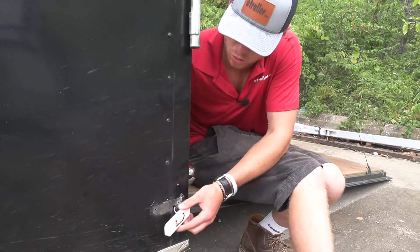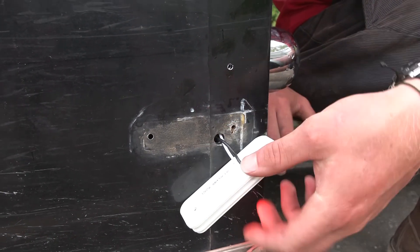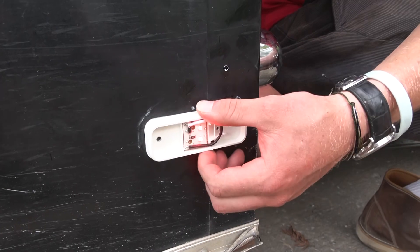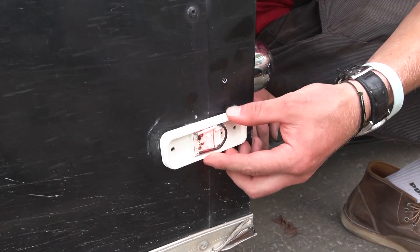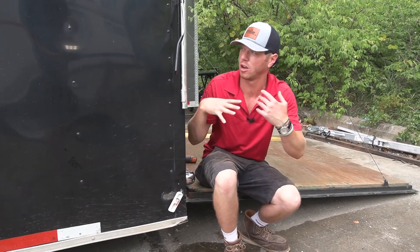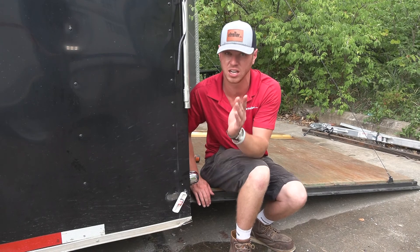Check that out - so the wires were good. It was literally just the housing itself that was all rusted out. That wasn't as bad as I thought. We had to do a little bit of drilling just to get everything through there, because the one that was on here was not available anymore - they stopped making it. But the reason why we grabbed this one: it was the same size, and it has a better seal, so it should not leak and corrode nearly as quick. This one's also LED, because LED is the way to go. They're going to last a lot longer and draw a lot less power from the vehicle. You should pretty much convert all your lights to LED if you're doing the work.